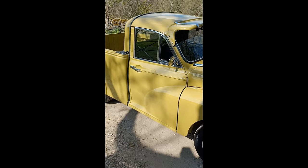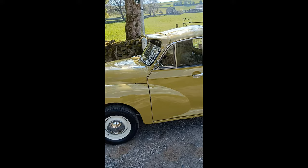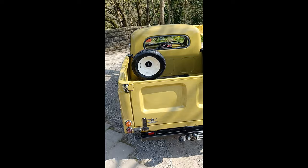Mr. Garwood — and here is what he got. It's a full build, stripped right down to the last nut and bolt. The chassis was repaired, blast cleaned, then powder coated. All the suspension powder coated, the axle powder coated. A reconditioned premium gearbox fitted, and a Searle engine, which we regard as the best.